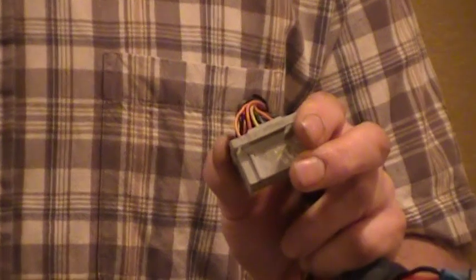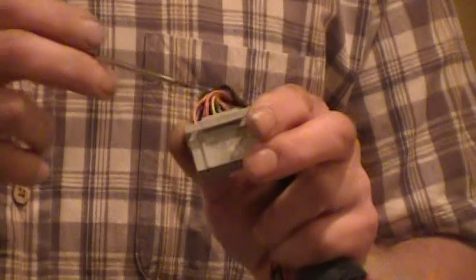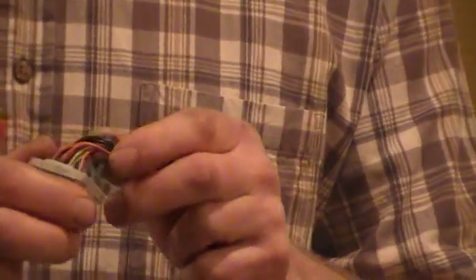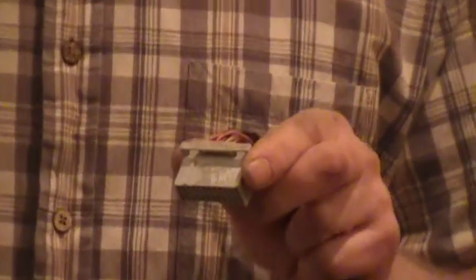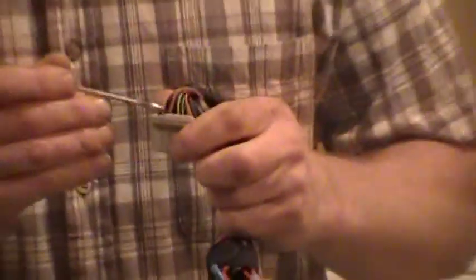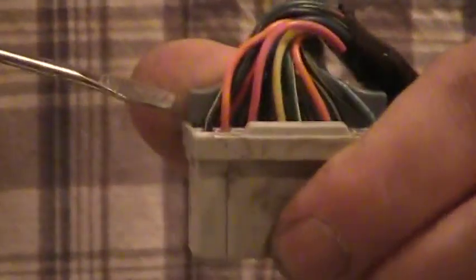On the 1999 to 2002 series, your two main power wires are generally A10 and B6, and the one ground is A6, which is black. On the 2003 and up, you're looking at a pink wire at B9 and an orange wire at B11 for the two power wires. On those, the two powers and ground are all right next to each other with one empty space, and the ground wire is black with a white tracer.